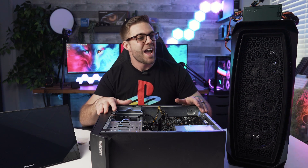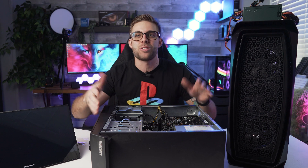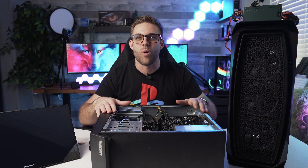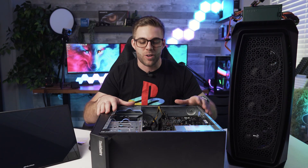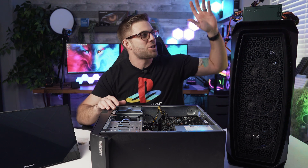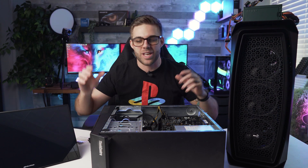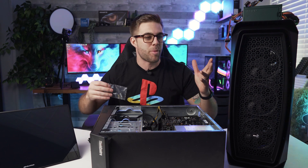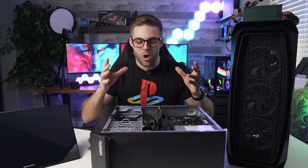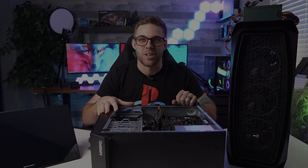It made a really good gaming computer and I was able to use the stock power supply because this graphics card doesn't use that much power. But the goal of today is something I mentioned a long time ago - to go ahead and case swap this baby. We're gonna take it from this boring old pre-built chassis and put it into this really cool racing car looking chassis with some RGB lighting. I'm going to show you how to do a few different conversions, including how to put a new power supply in using an adapter, and how to retain the USB 3s on this motherboard.